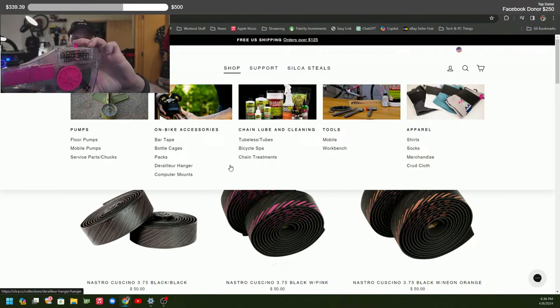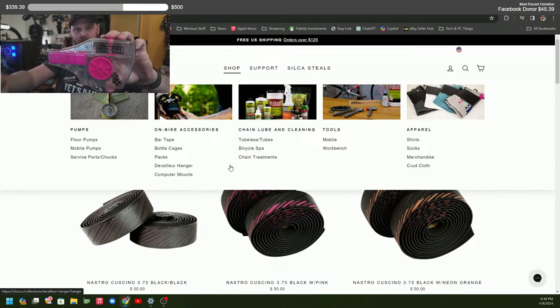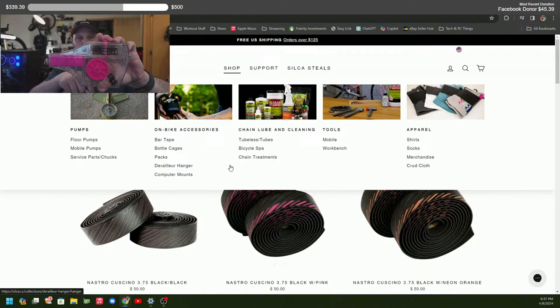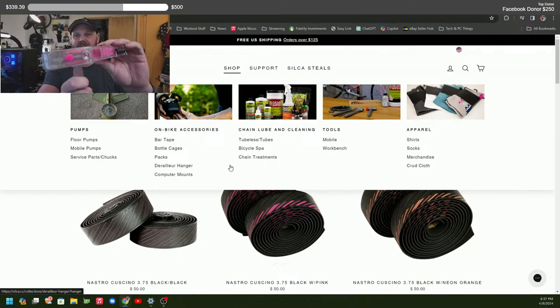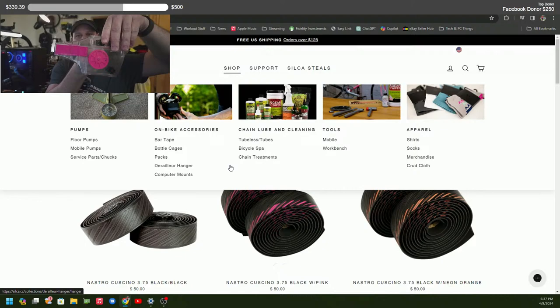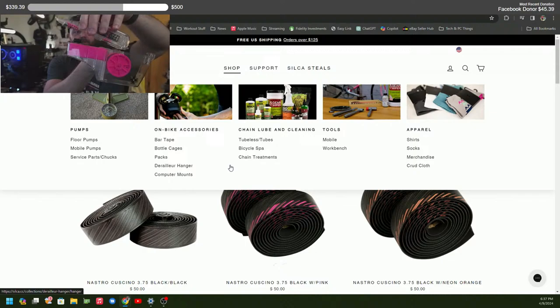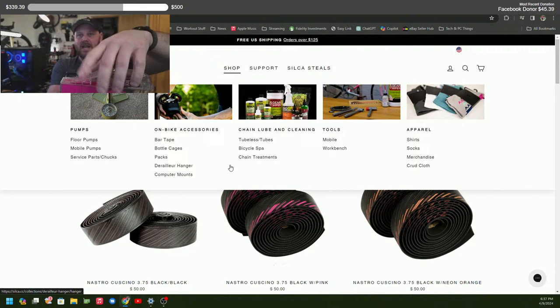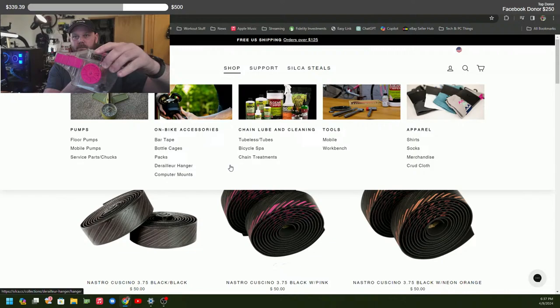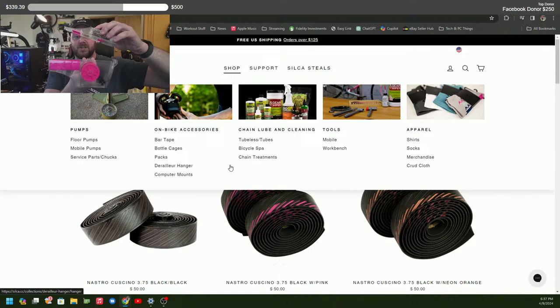Ooh. But anyway, you just put a fluid in through here. It sits inside of this upper chamber. As you roll your chain through it, you just hold on here and you can hold this down and either dump the liquid slowly over the top of the chain. It leaks a little bit, so you'll get some that'll roll through. And then just keep running it through, and the different brushes and contraptions just pop in, hold down, latch, so you don't have to remove your chain. And then you can use your own cranks on the bike to help with cleaning your chain.